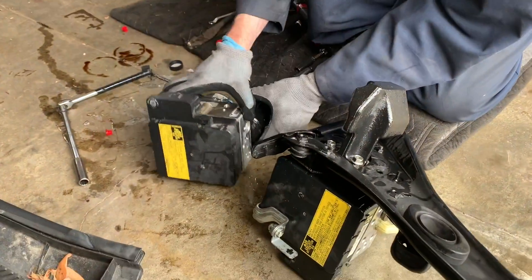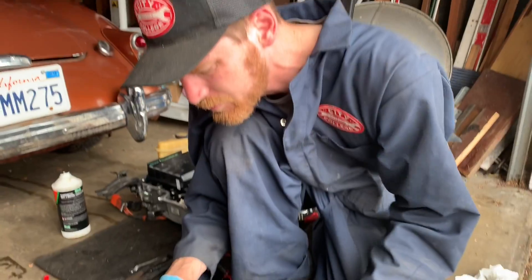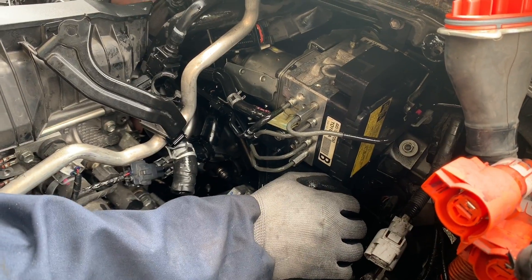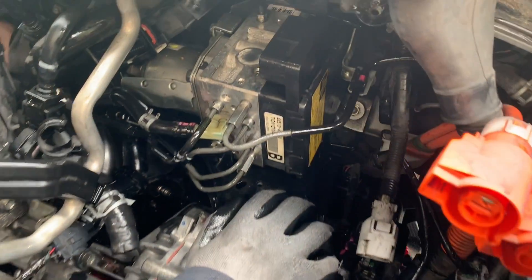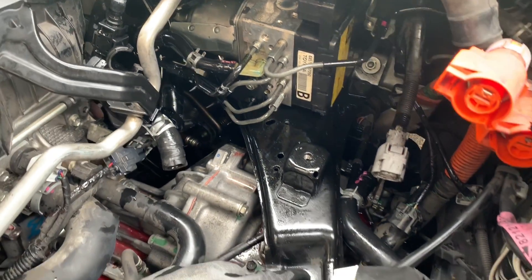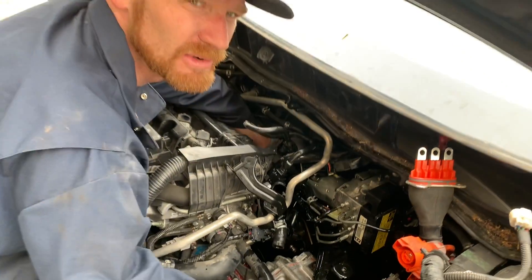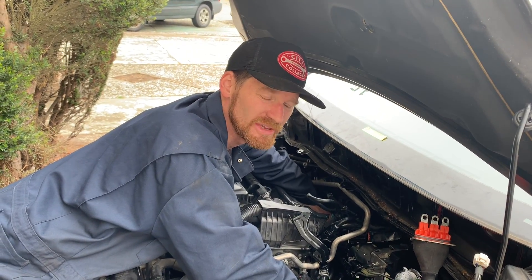Here's the old unit and here's the new unit. I've transferred all the brackets from the old one to the new one. The brake lines are reconnected to the new ABS actuator and the bracket is set in place. I'm installing everything in reverse of removal — starting with the big bolts that hold the bracket, then reconnecting all the lines and plugs. Then we'll go through the bleeding procedure that the scan tool leads us through.